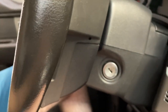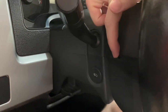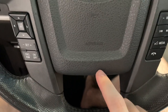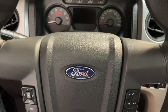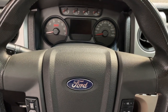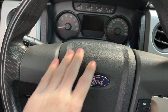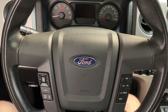In order to get the wheel off, you need to pull the airbag. To do that, you've got three holes — one right here, one on either side, and one on the bottom kind of directly underneath the airbag. It goes without saying, but make sure you've disconnected your battery for quite a while before you start working on any of your airbag stuff, whether it's the pillar ones, the driver's side steering wheel one, or anything as far as the airbag system goes. You want everything discharged — you don't want an airbag exploding in your face, especially with tools in between it and you.